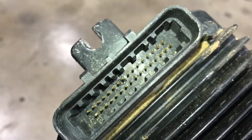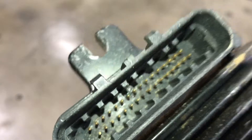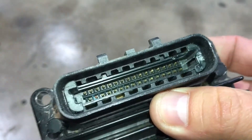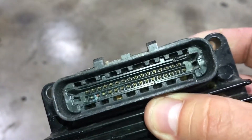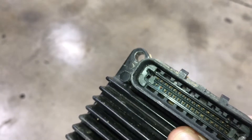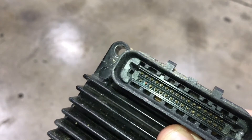Not only was this — both sides were full of sand, you can see in there — there's a little moisture, and this was actually water and sand in here. On this side, the actual cap came off the plug, and you can see right there there's a corroded pin, which is not abnormal to find in these connectors.